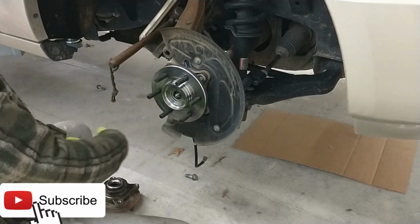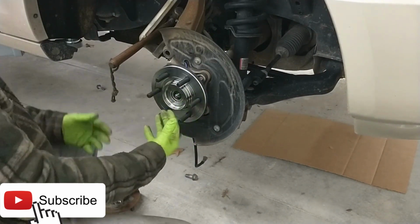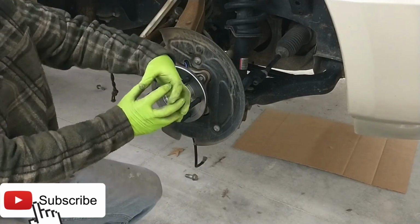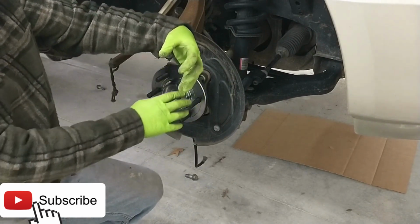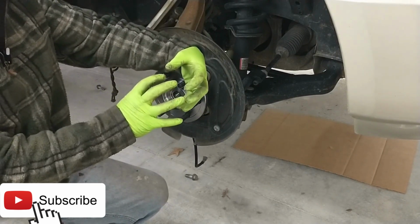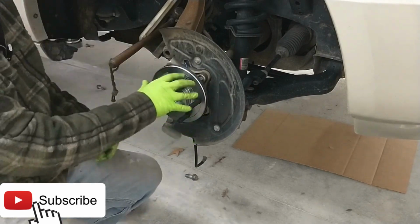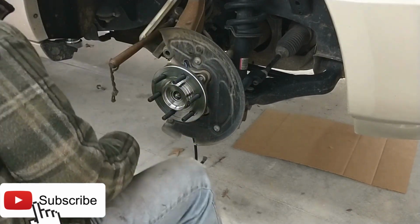You see how it's free moving now? Remember, it was locked in place before. Those are those gear splines, now that the vacuum has pulled back out of the way like this. So we're freewheeling here. But before, and whenever the car's off, they come back out and lock up. And you turn this, and your axle will turn.